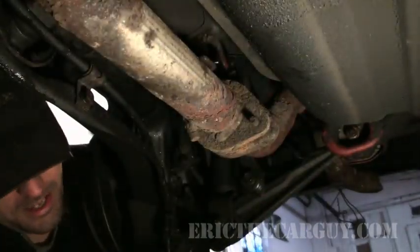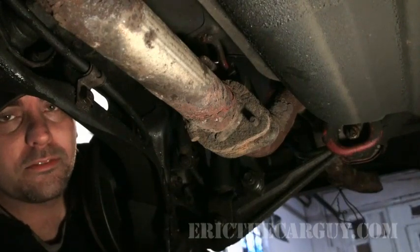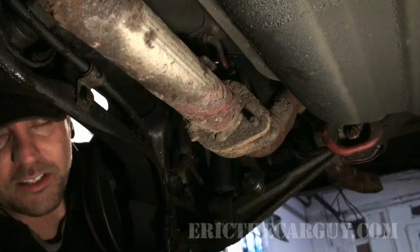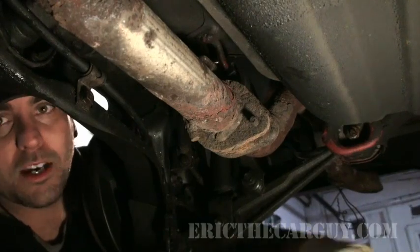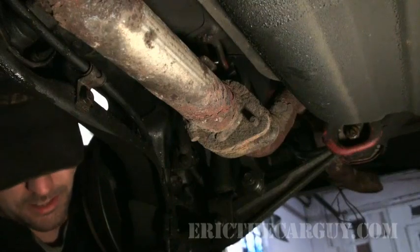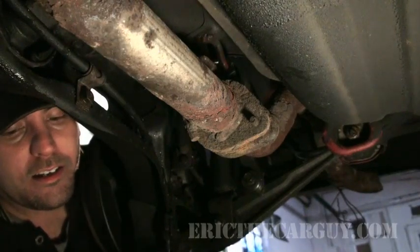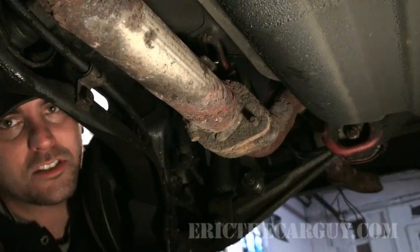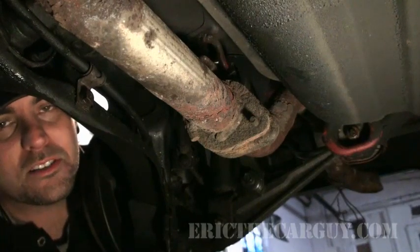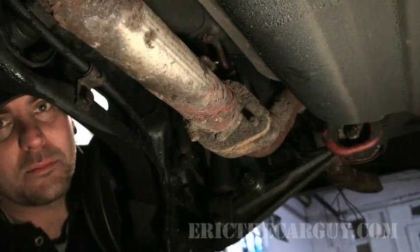Also, as you're heating this up, little pieces of rust and things will come flying off, and they may touch bare parts of your skin. If you can, wear some kind of protective clothing, like I've got a jacket on here and these gloves and all this other kind of stuff. Definitely protect your eyes. But, the point is, try not to flinch. I know it's going to be hard sometimes. Some of those things are really hot and you have to get rid of them, but that's the kind of thing that may get you into trouble.